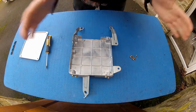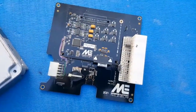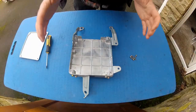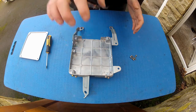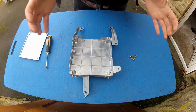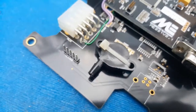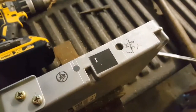I've put the stock ECU to one side, leaving us with the bare ECU chassis. As the ME221 is a plug-and-play ECU, the factory harness is going to plug straight into it — the plug sockets on both ECUs are the same. But there are a couple of extra things we need for the ME221: a manifold pressure line, or MAP line, which is a 3mm or 4mm vacuum line running from the intake manifold to the barb on the ECU. I also need to drill a hole for the tuning cable.